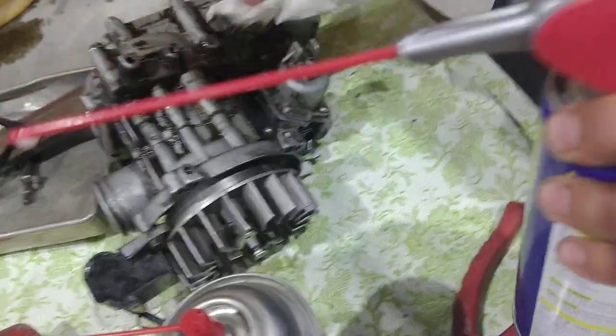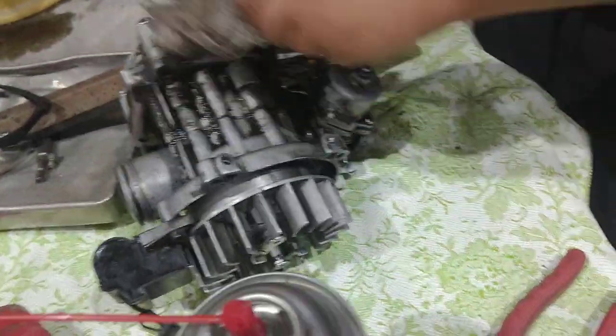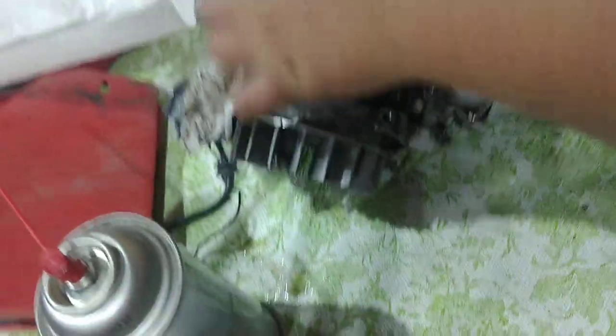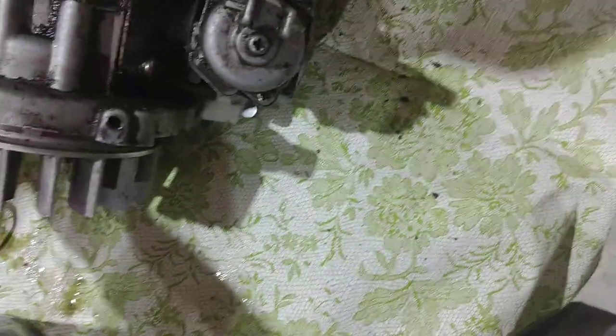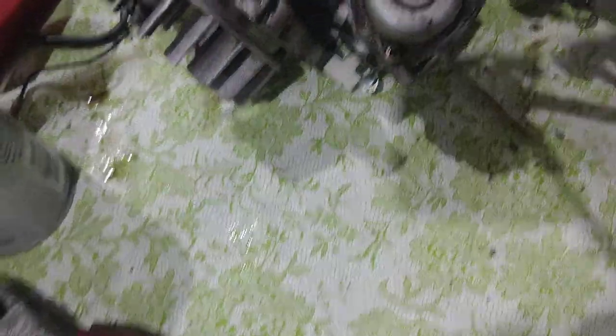Make sure there's no leaks. I know this older fellow and he told me that if it has any leaks it's not going to be able to function, because the carburetor is linked up to the crankcase — it goes through a reed valve into the crankcase, then it comes up with the piston and combusts. So you get pretty good lubrication with this setup. I like it — I think this is a cool little thing.